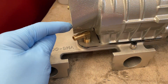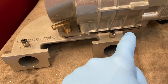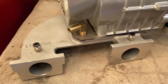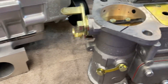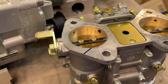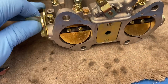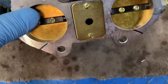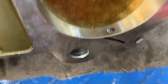There will be link pipes going from each barrel of the carburettor — so this side will go across to here, and this side of the carburettor will go to here. That will just make throttle response crisper, and if any fuel leaks out of your carburettor this will make sure that there's no residual liquid fuel in the lowest point of the carb.